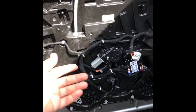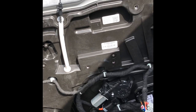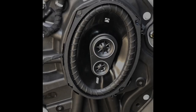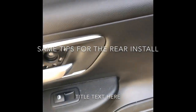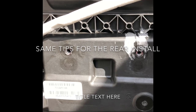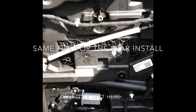Now I'm putting the panel back together — reconnect the door lock switch and the interior handle, then push it in, put in the two screws and one screw, and you're done. The speaker tested and sounds great. Most clips go in and there are three 10-millimeter screws — two in the middle and one by the handle. Same process for both front and rear doors.